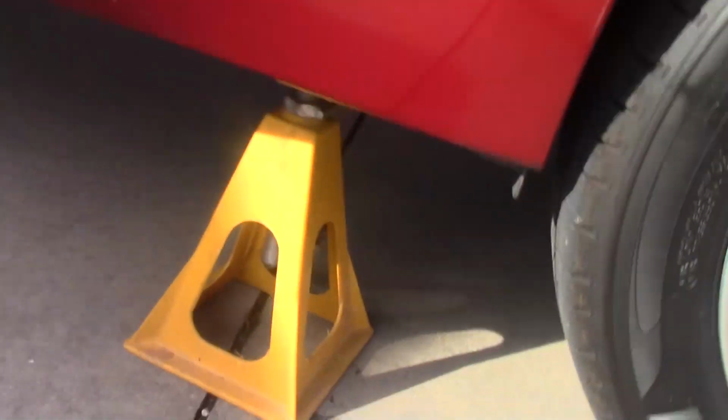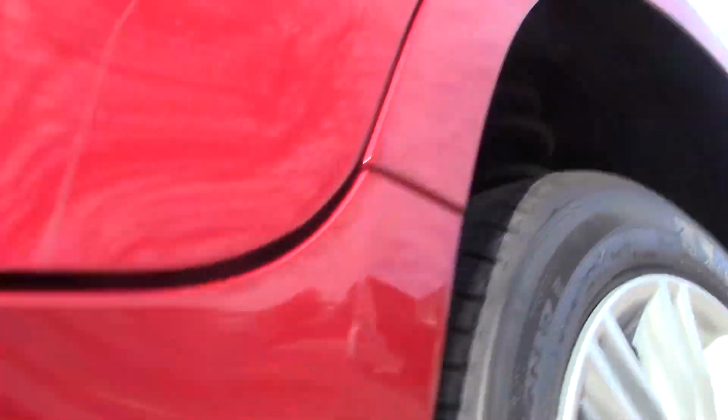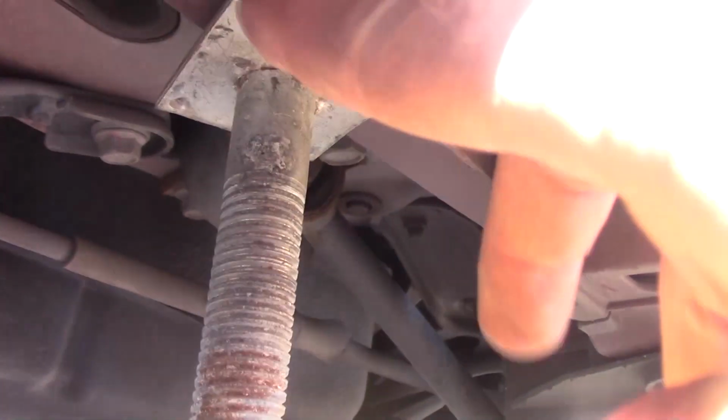Okay, I couldn't find a place that I was comfortable with behind the suspension here, a flat piece of the frame. So what I've done is leveraged the information that I have about where this pinch weld exists, and to know that it's reinforced on either side to sustain the scissor jack.